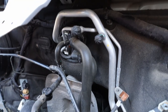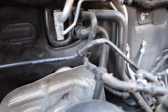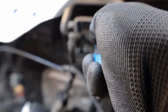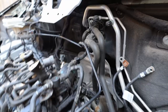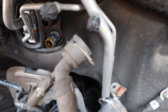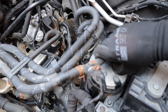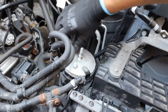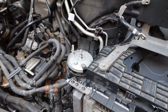Next up, I'm just going to remove these two hoses from the heating system. They're on little retainer clips so you need to pull those out first with a screwdriver - one's at one side, one's at the other. They should just pull off; they do just pull off once you've got the clips in the right position. There's actually a little guide on them to pull it into. And the last set of hoses, I believe, which need to come off are these from the top of the fuel filter. Just squeeze them in and pull them - a little bit messy. There's two of them on top. Diesel going around, but I'm just going to cover those up with a bit of glove or something so nothing goes in them.